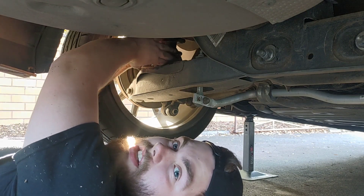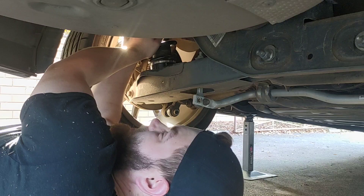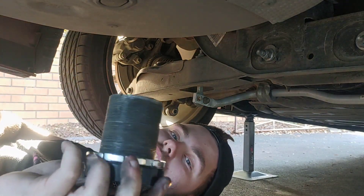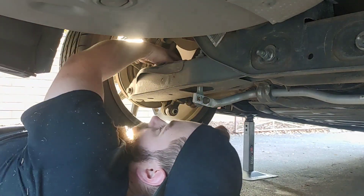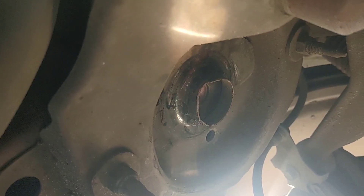The hardest part of this, almost always, is pulling the actual spring itself out. Despite not having to pull the sway bar out everything still sits relatively tight, but with a little bit of force — that's our spring right there. That's our top hat — so that's what we're getting rid of today. As you can see I've already taken a locking ring out of it to get it to sit lower, but it never really sits quite low enough to where I want it to be, so we're just going to run it like this. The rubber insulator is still on the pad up there. All I've got to do is put the rubber back on. This is just the standard spring rate from BC — it's just an 8K. The fronts have 12K just for reference. We'll bolt them back together and start doing the other side.